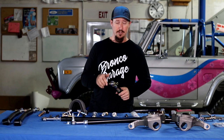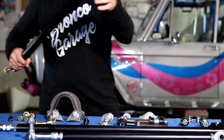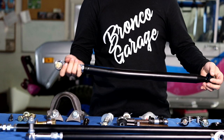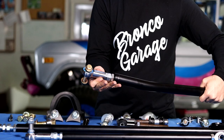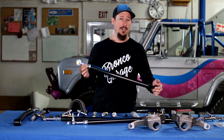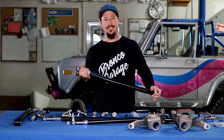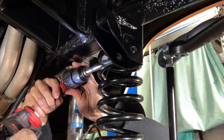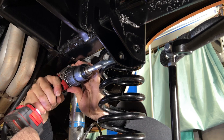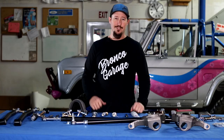James Duff has come out with something even better: the new hassle-free heavy duty track bar. It comes standard with the heavy duty end but also has an adjustable bar already built in, so when you install it and want to get your alignment just right, perfect alignment options are built into it. Normally when you install a track bar you've got to take the bolt off, bring it down, twist it left or right — you never quite get it perfect. With the new heavy duty hassle-free track bar from James Duff, you don't have to do that anymore. There's also a kit to drill out a loose bolt hole so you can run a five-eighths bolt — a heavier duty bolt — and not have a wallered-out hole, which introduces bump steer and death wobble.